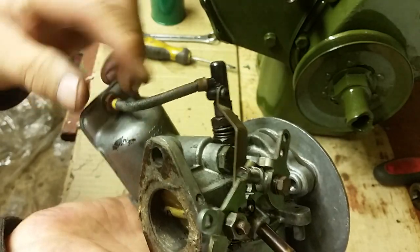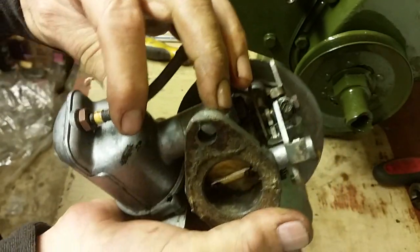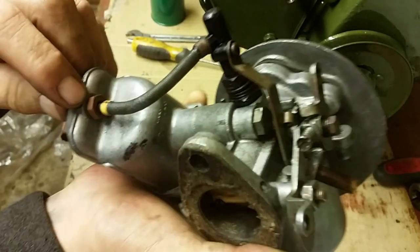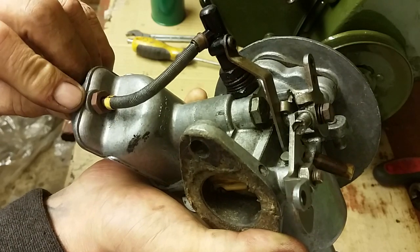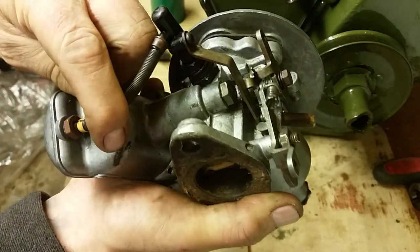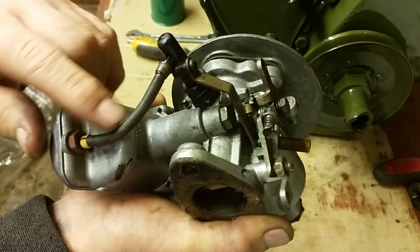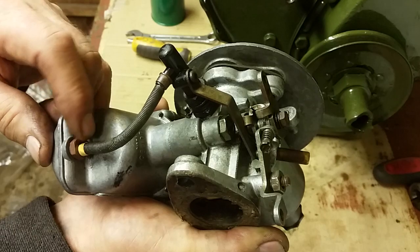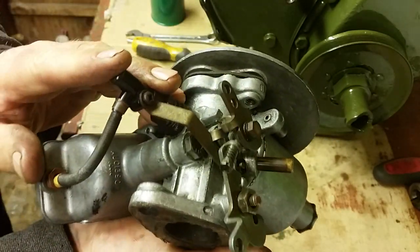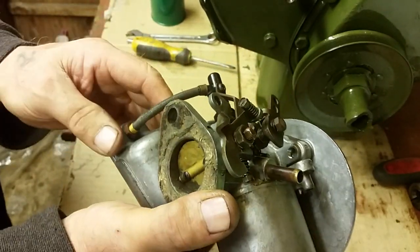the carburetor at all, because this here, the jet part of it, is a very, very flexible little pipe, and it's a little plastic tube. It fits into the back here, and there's a little brass olive that fits onto it, and I can tell you now, if you try and undo that, you'll never get it back together again. You'll end up buying another one. You'll leak fuel out of the bottom of it, and it will never be any good. So it'll cost you money. So leave this jet well alone. Keep your hands away from it, because it's very, very fragile.